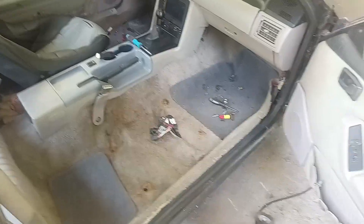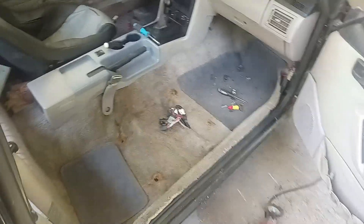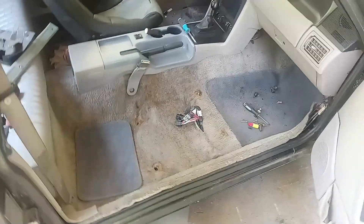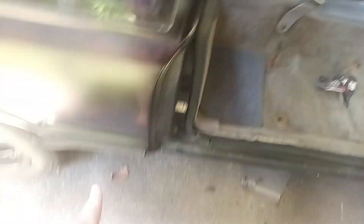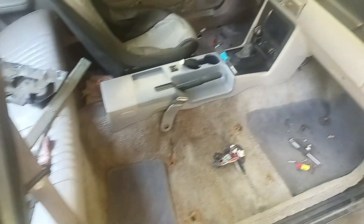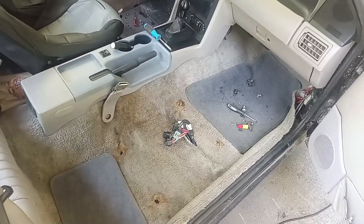I need to see what I can get cleaned up in here and finish putting this together. I'll probably leave the passenger seat out for a little bit longer since I've got some other projects to do. Sound deadening is under there now — there was no factory sound deadening back here, which I thought for sure there would be, like in the front. I think that'll help quite a bit because that's the area of the mufflers — that's where you get a lot of resonation. The mufflers sit right there, so that reverberation of sound is going to be in that general area. Making progress — progress is a process, right?